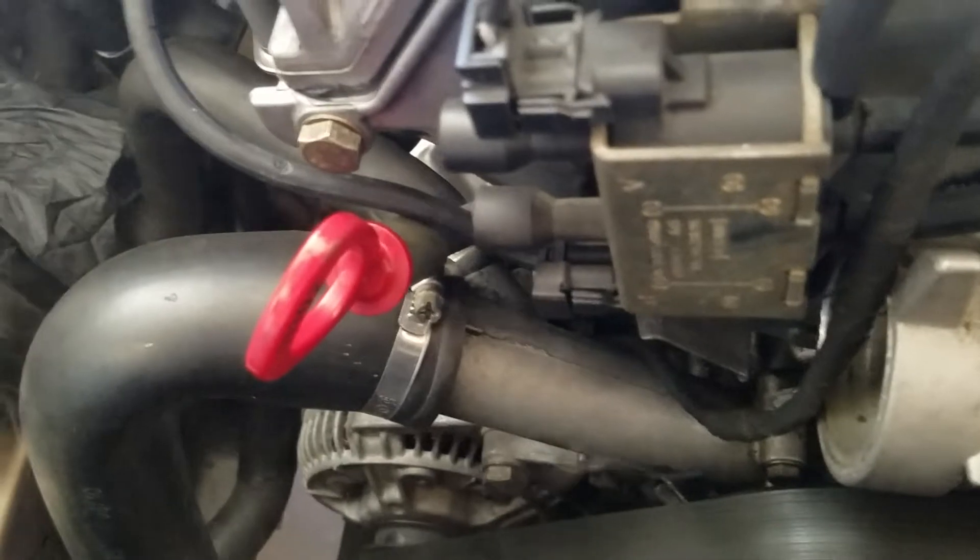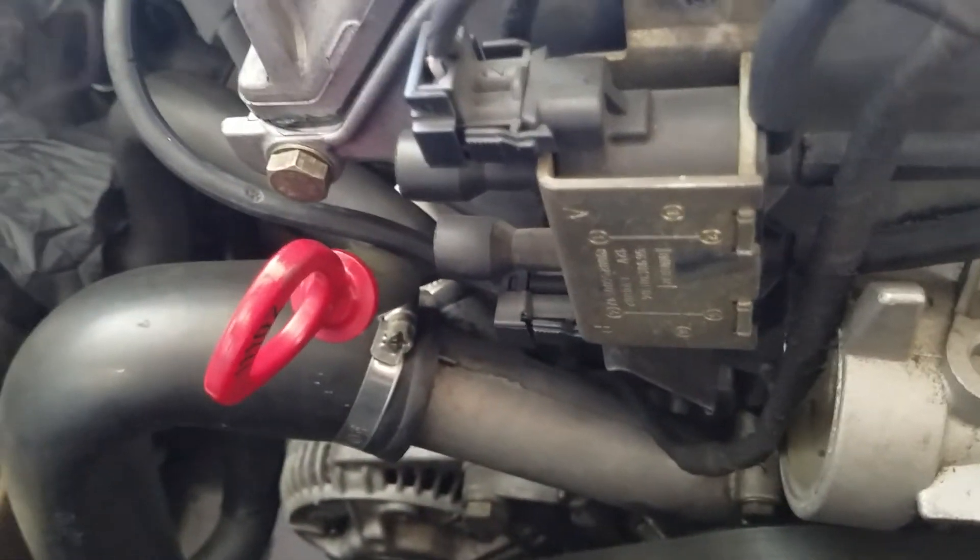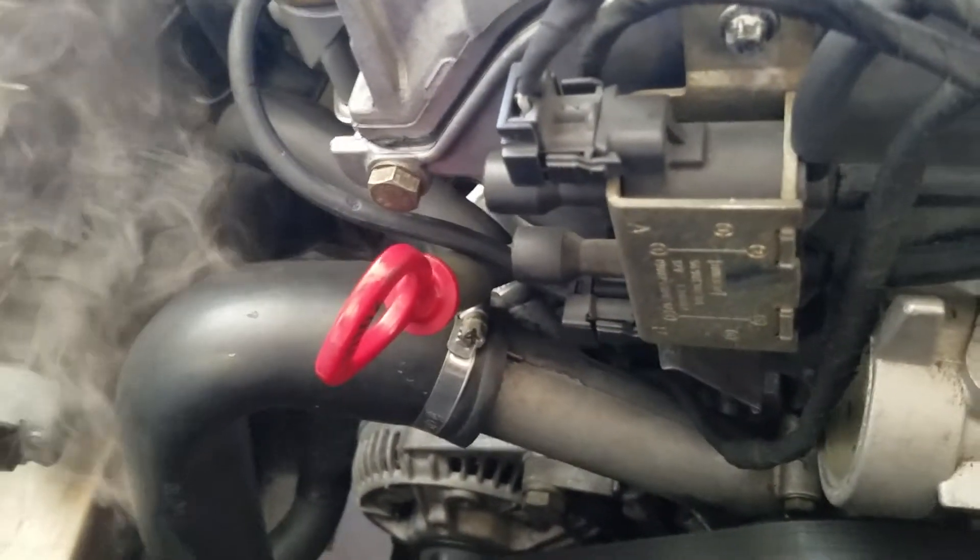There goes my glove. Smoke test is over. Something I noticed while I was filming: I've got smoke coming out of the oil dipstick tube, so time to replace the O-ring in there. And that was my setup. Hope it helps.